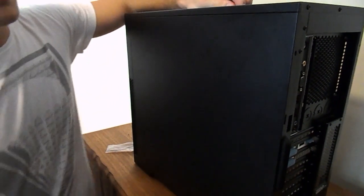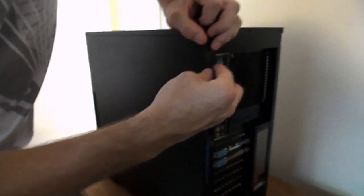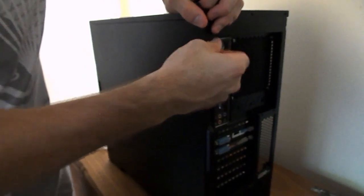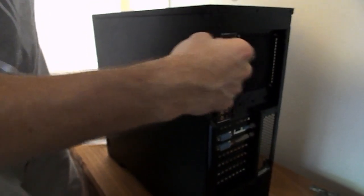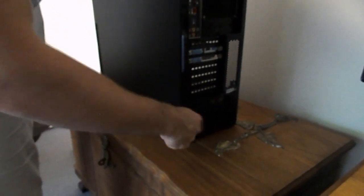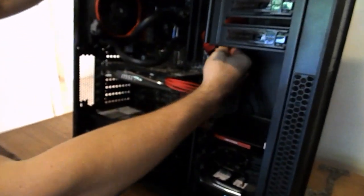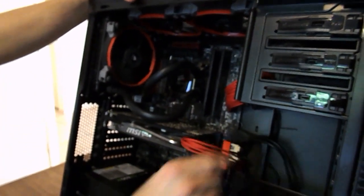Now we've just gone ahead and put on the back because we didn't want to show you how hard it was to get on. Took us a good few minutes to really push that down, really get it on there. If you've done good cable routing, it wouldn't have been as hard, but we didn't, so it was hard. So go ahead and whack those thumb screws back in. If you don't have them, you'll just have normal screws which you just screw back in. We don't want you to have to force the back plate on so hard that it's bulging and you're compressing cables or anything like that, because after a while, guys, the cable might deteriorate or sever or something like that, and that's really not good.